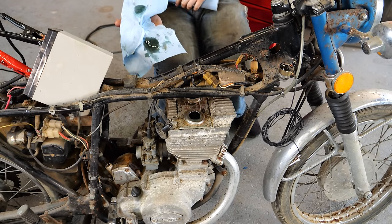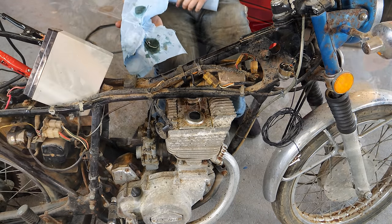Look at that. Okay, so my current working theory is that this thing sat for a long time and maybe the injection pump leaked, even though it's uphill, but it's below the fluid level, so possibly. And I think what it did was fill the bottom of the crankcase with oil. So I've got the plugs cleaned off and shoved back in. Give it a little more juice. Oh shit, that ran.